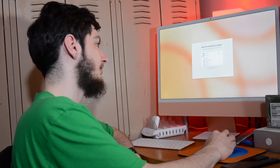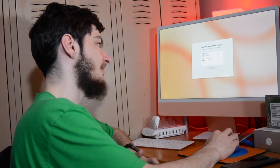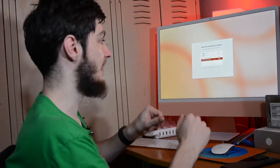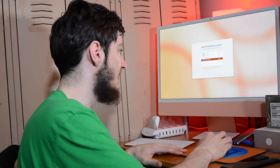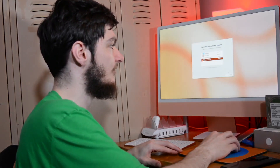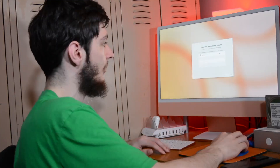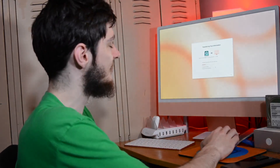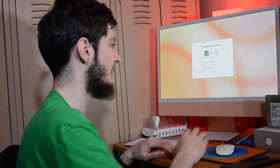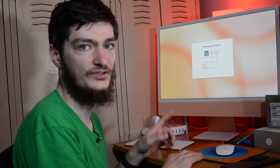Choose what you want to pull over — you have your user files, and you can punch into the hierarchy to see what takes up what space. It'll take a moment to cache the backup data. My backup is 83.4 gigabytes, leaving about 128.55 gigs free after transfer. Click Continue, set an administrator password, and continue again. It'll take time to transfer — currently estimating about 46 minutes at 32 megabytes per second. Take a break and come back when it's done.